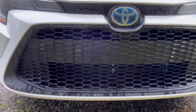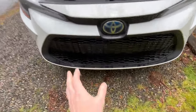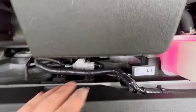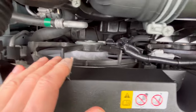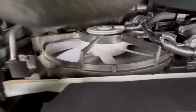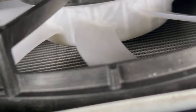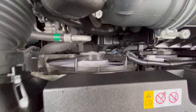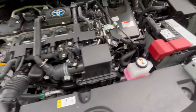So I just zoomed in through the grill. Air hitting the front of the car goes through this radiator. You'll see here's a fan, and here's another fan over here. What these fans do is the electric motor in the center here can spin that up — you can see the back of the radiator right there. Those fans help to suck air through the radiator. That's to cool the coolant for the engine. There are coolant lines here for the inverter, and the engine has coolant too.